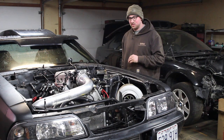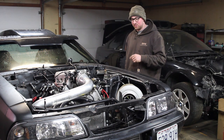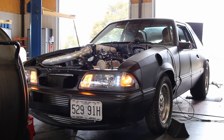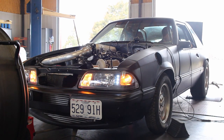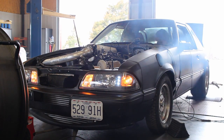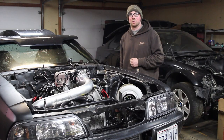We'll see how much I left on the table at the dyno. From the plugs it looked like it could have used a few more degrees, and you could tell by how much smoke was coming out of the exhaust — it was running a little rich. I was playing it safe and pussyfooting around, and it kind of bit me in the ass because I was on the dyno from like 9:30 in the morning to 1:30–2 o'clock in the afternoon.